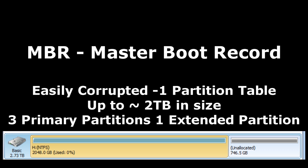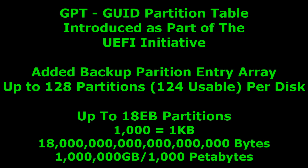Normal hard drives run on the MBR, the Master Boot Record. Issues with this, as I'm sure you're aware: it's very easily corrupted, only supports up to 2TB in size, and you can only have 3 primary partitions — the rest have to be logical. So as you can see from point number 2, having an MBR format on this hard drive isn't going to work, so we're going to switch to something else called GPT.